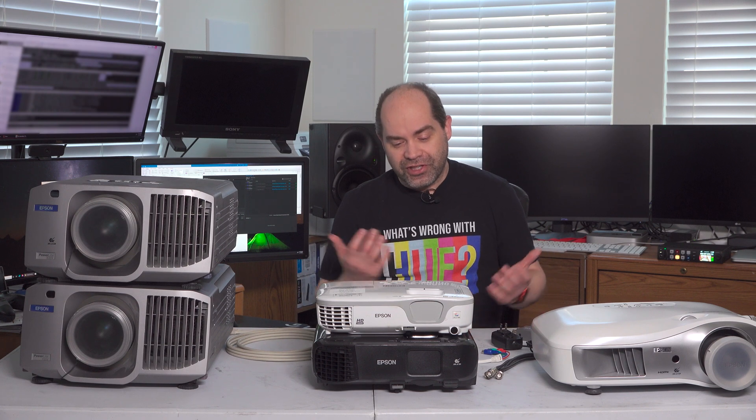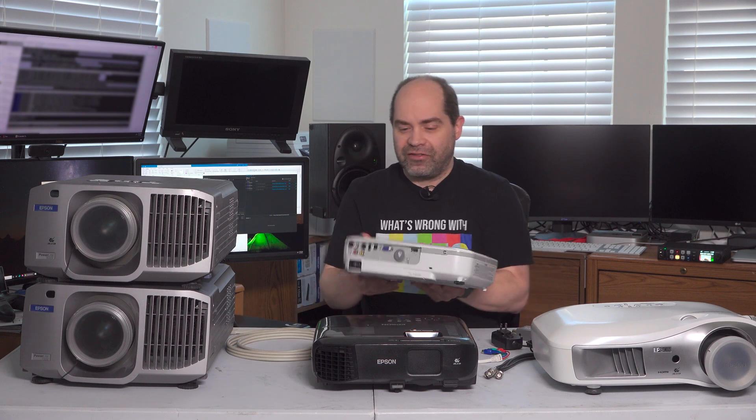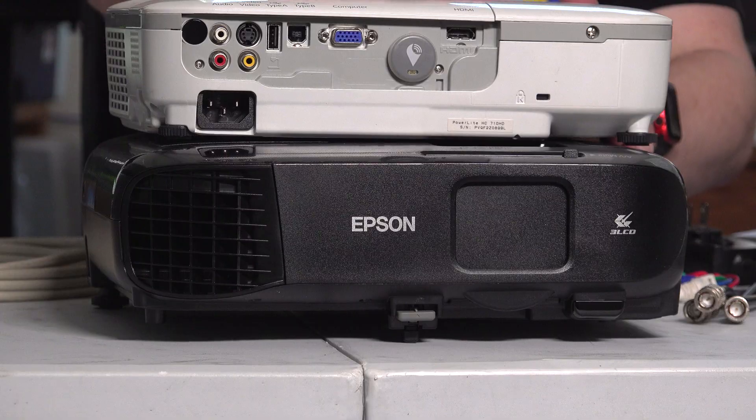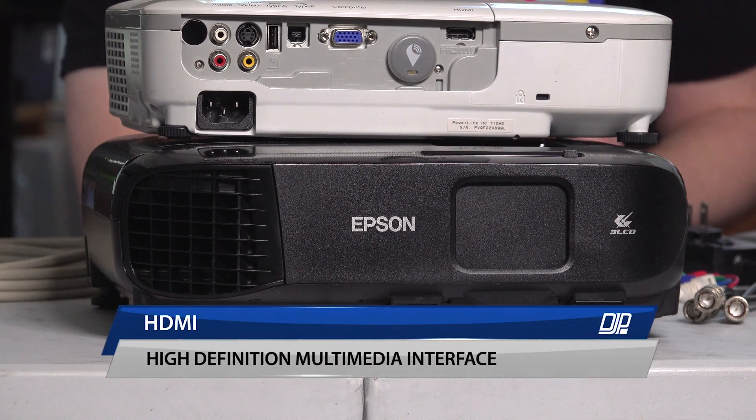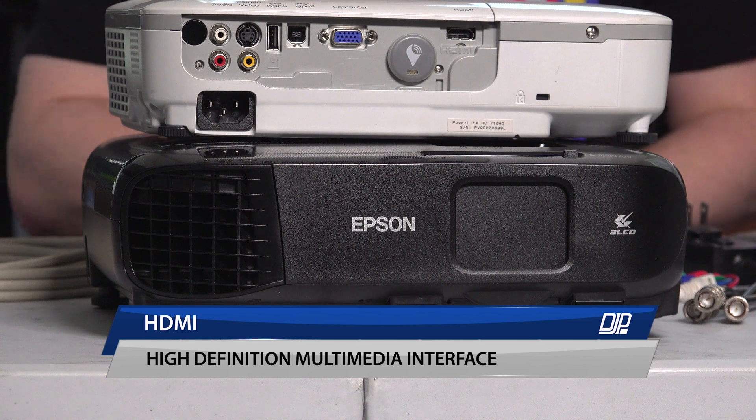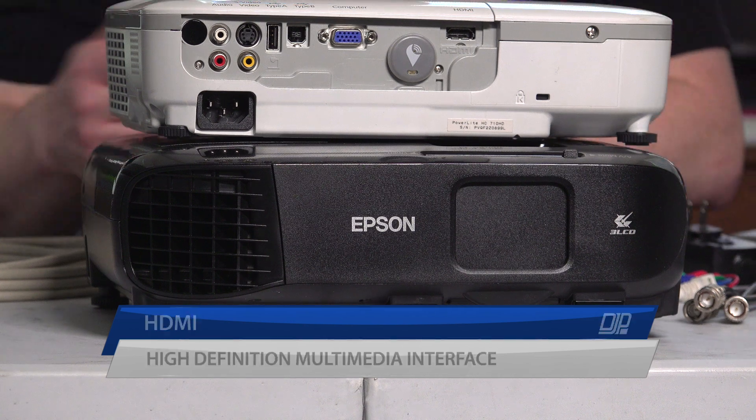This is only a handful of the ones that I have. I'm going to connect up to your video switcher, or a playback device, or whatever you happen to be using. Obviously, the easiest thing to do is if you have a projector that actually has HDMI on it. If we flip this around, you can see on the back it's got an HDMI port. You just take the HDMI output of your switcher, or take an SDI-to-HDMI converter, plug that in, and you're done — everything works great.